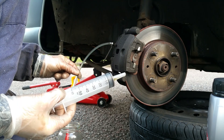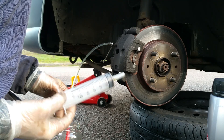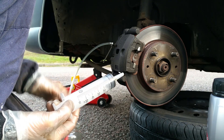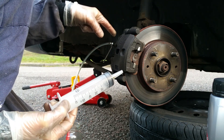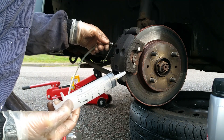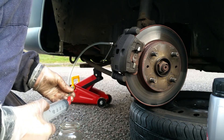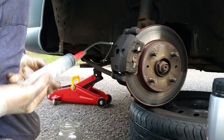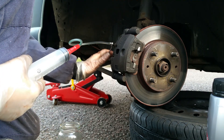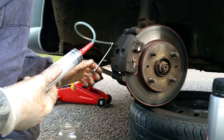These are used along with this tube here for feeding of calves, lambs — that kind of thing — if they need to be hand fed. It comes with a tube with a little hole in the end which emulates a teat. What you need to do is just chop the tube off at the end, and you might need to heat it a little bit so it'll fit over your bleed nipple. This end fits onto the syringe, and you've basically got yourself a cheap budget vacuum system — like a Mityvac.